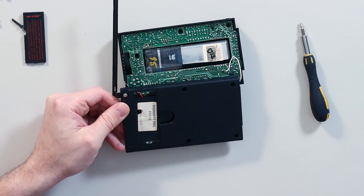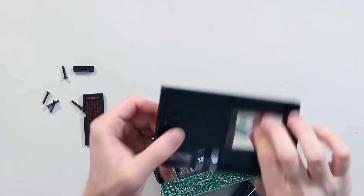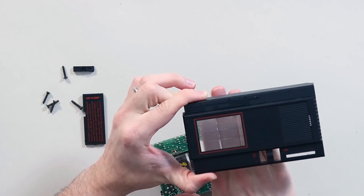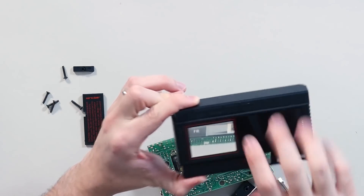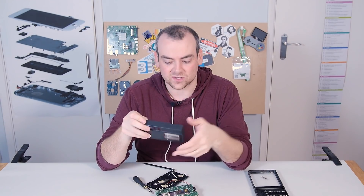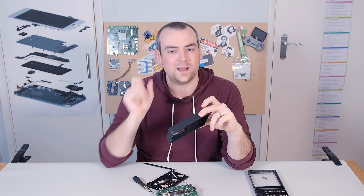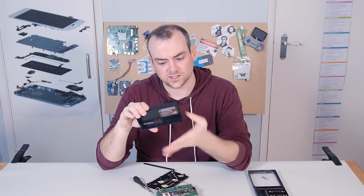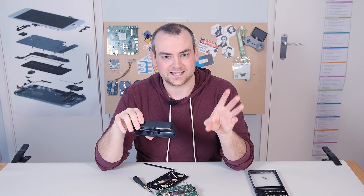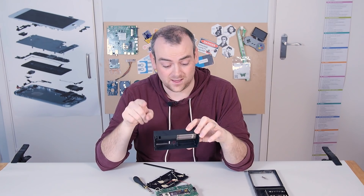The obligatory warranty seal is no longer intact. At the front, to make the screen larger, this is called a Fresnel lens — it's not actually just a plastic cover. Fresnel lenses are the cool things you've probably seen people make solar cookers out of. They're not a single curve; they're actually little compound bars which make up a single lens. If you want to see a cool application, look at the automatic landing assist lights on aircraft carriers that use Fresnel lenses.